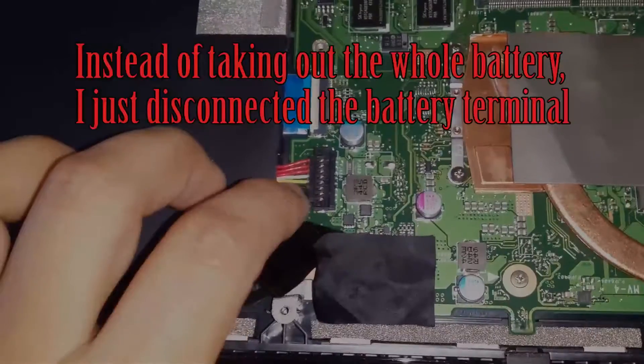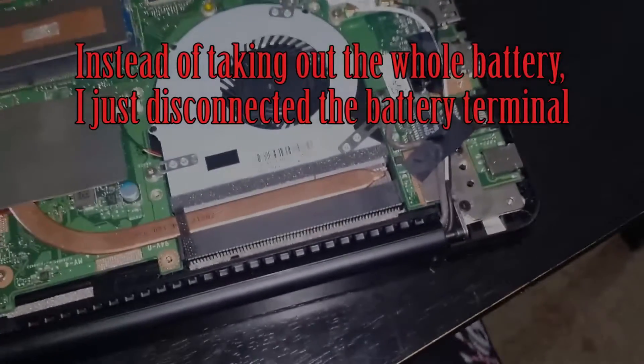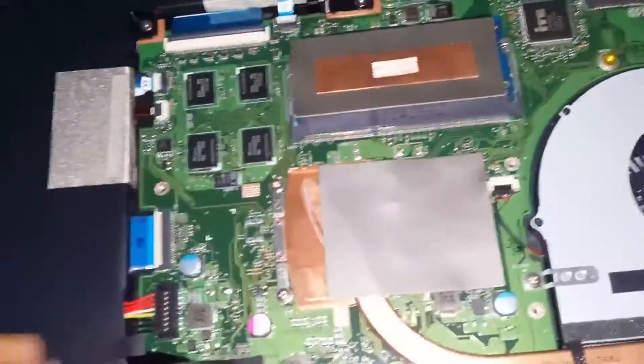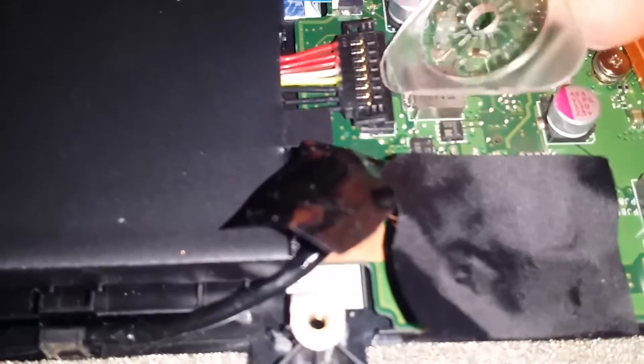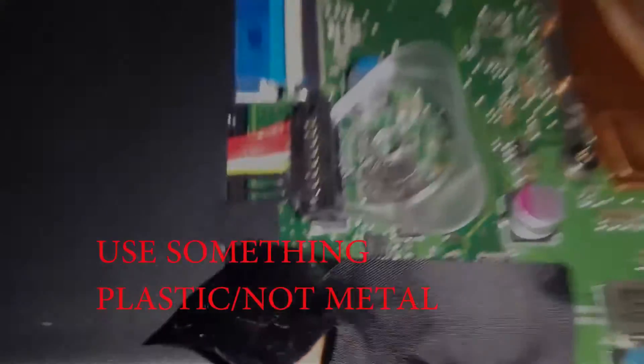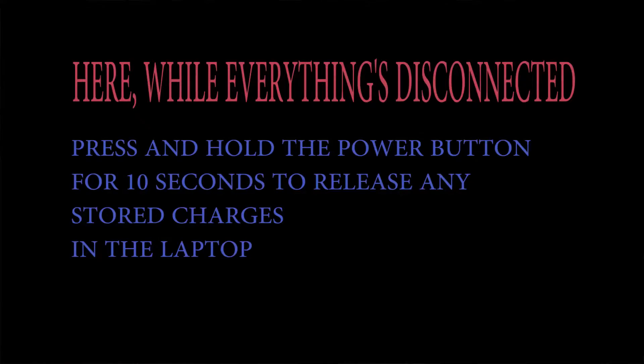This is the battery connection — this is where the battery is getting juice. I plug it in there and I wasn't getting anything, so there was something going on. What I did was I got my little tweezers, popped it up on both sides. I didn't want to short anything, so I used this — like a guitar pick — and I put it right there between the terminals just to make sure the battery is completely disconnected.